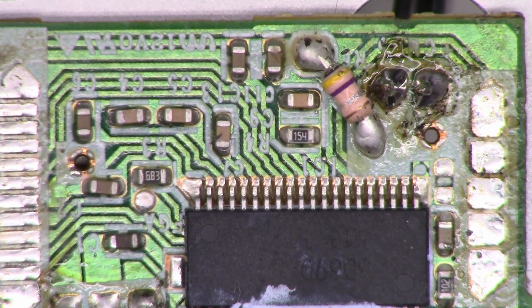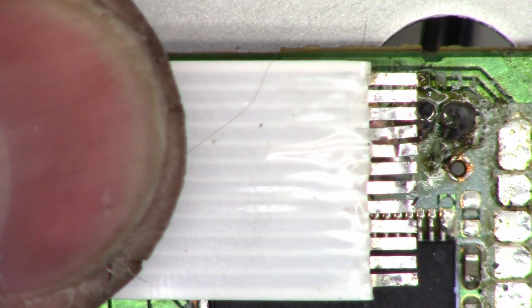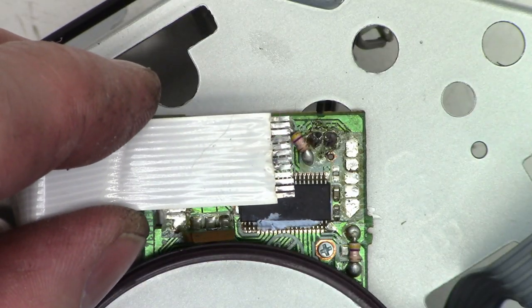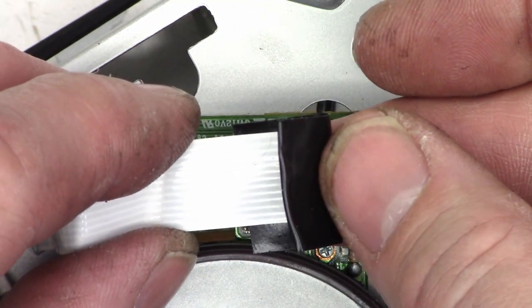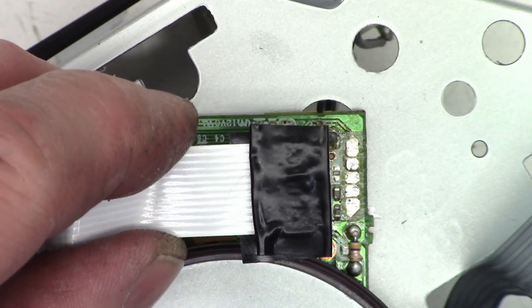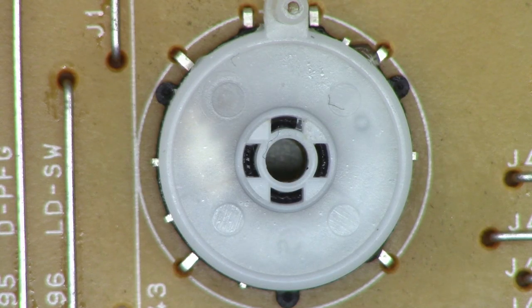Do not forget to reattach the loading motor. You may also want to prep the ribbon cable from the capstan motor to the main board, just to make sure it has evenly spaced pins that will solder back to the pads on the circuit board. Here is another tip when reassembling this unit: take a piece of electrical tape and stick it to the back of the unit, then fold it over. That way, the pads on the ribbon cable you have prepared will not be damaged when you stick it up through the board — they are extremely fragile.